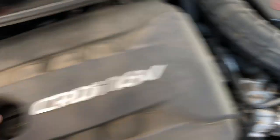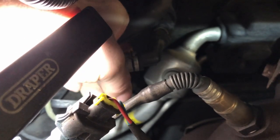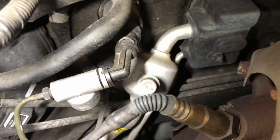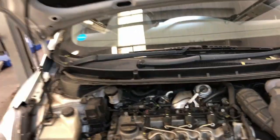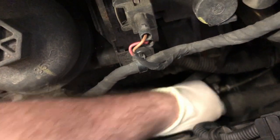Right, so we've got the Hyundai in the workshop and I've been doing a bit of investigation on these. Apparently this unit here is a damper, but it actually looks like it may have already been bypassed - so that's not going to ring true is it? It looks like someone's replaced that with a hex head, so I don't think it is that. So what I'm going to do is get it on the ramp, get the under tray off, take a closer look at the slave cylinder, and clamp it off to see whether the pedal stiffens up.